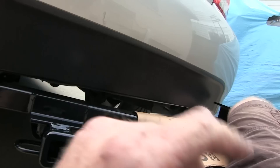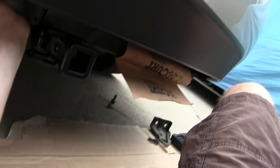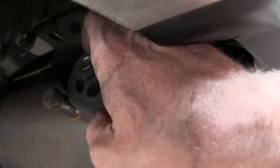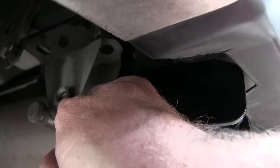I was pretty sure I'd have to remove the bumper but it is actually squeezing in there. Then you just kind of slide it in, over and up — and there we go, now I've just got to get the bolts in there. I see this muffler hanger bracket — it looks like they drilled the hole too low; it should be up a lot higher. I don't think that's going to work, so what I'm going to do is just reuse the original bracket. It will be hanging like an eighth of an inch too low because of the steel, but it will be better than the stock one.